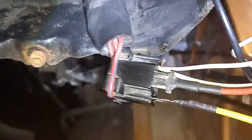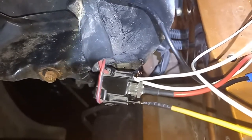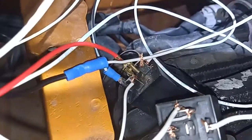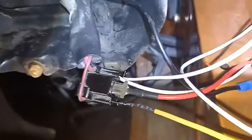These act as the switch. You have a constant source of power that's on whenever the power is on to the headlights, and these, depending on which negative switch is on, whether it be low beam or high beam, that feeds a negative. You can think of it like a negative signal to the relay, which suddenly triggers with your power source from here, and then powers your headlight.